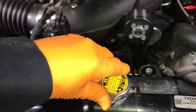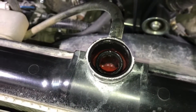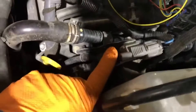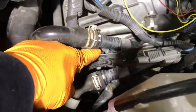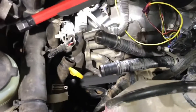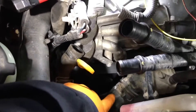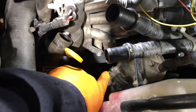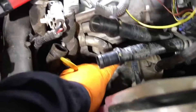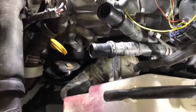After draining, we're going to open the cap. I already bled the pressure off from the bottom. While the coolant is draining, we'll take these clips out and disconnect the connector and unplug the air injection tube. Now that the air injection hoses are disconnected and the wiring is out of the way, we just need to undo the lower radiator hose clip, take the hose off the thermostat housing, then undo these three nuts — there's one more below — and the thermostat housing with the built-in thermostat will come right off.